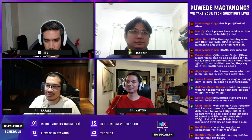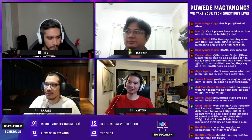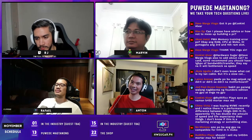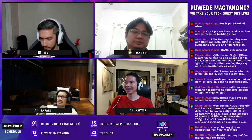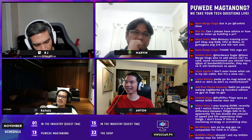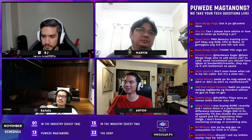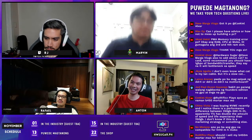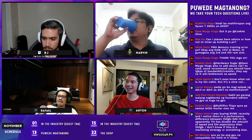The Borbs from YouTube asks, is it okay to use a Kraken M22? The M22, that's an NZXT AIO, and the RAD is 120mm. Personally, I recommend to all our customers that if it's just a 120mm RAD, regardless of the brand of AIO, the cooling is really not so good with a 120mm RAD. At least minimum, if you're going AIO, go with a 240 RAD.